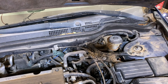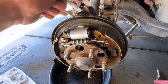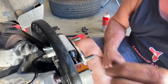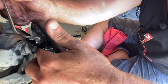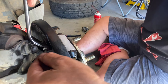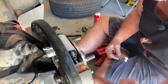Now let's go back to the furthest wheel, which is going to be the passenger rear wheel, and we'll start to bleed the brakes. We're back here on the rear passenger side — this is our brake cylinder, and this is what we need to bleed. That little nipple coming out right there is our bleeder valve. Make sure you have a drip pan underneath. Take an 8mm wrench — whatever size fits your particular application — get it on there. Remember lefty loosey on the reverse side, so we're just going to open that up a little bit. Now we wait until it stops bubbling.